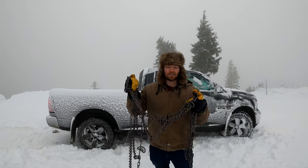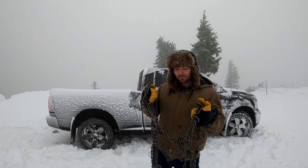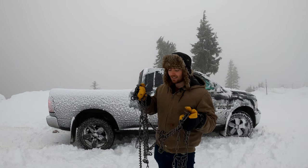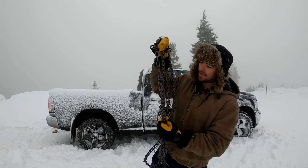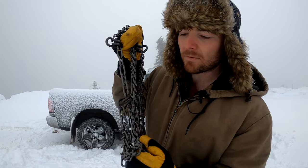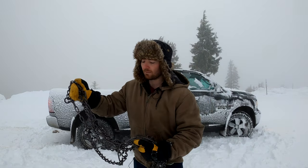As you saw, we really didn't get anywhere in two-wheel drive. In four-wheel drive, we'd probably be just fine, but for the point of the video, let's just call ourselves a little bit stuck. So what we're going to do is slap these chains on. They're called V-bar chains — if you can see the little Vs on there — which is one of the most aggressive types of chains you can buy, which is exactly what we need.